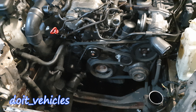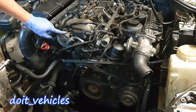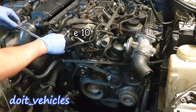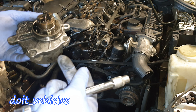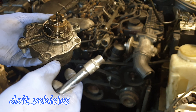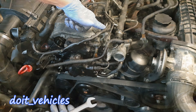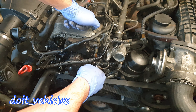Let's take out the hose from the vacuum pump. The vacuum pump is held on by 2 bolts — use an E10 and remove these. Since we're going to be removing a lot of parts, it's important to keep the bolts in their position. I like to keep them on the part itself when I remove it, so I know which bolts go where. Next, let's remove the fuel line from the high pressure fuel pump — you'll need a 14mm.